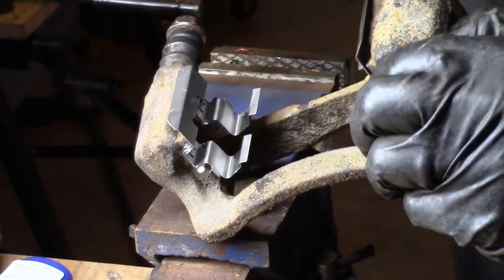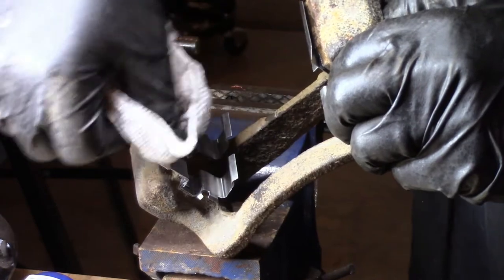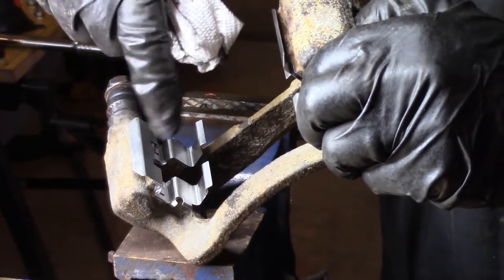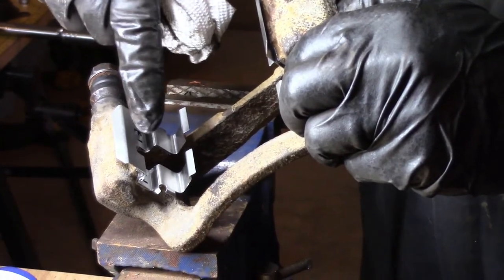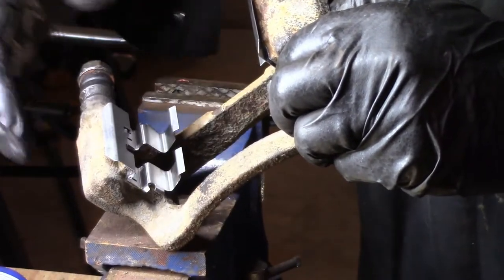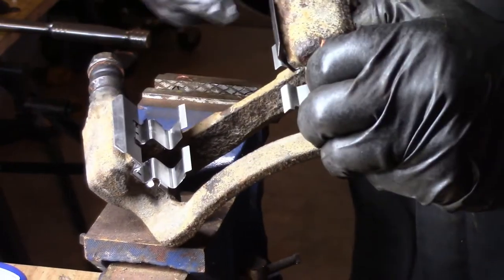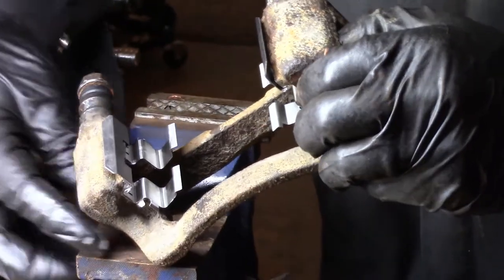Darn it. I find it's not as good if you put grease on here. It's not effective. It actually makes it worse because you get brake powder dust coming off the brake pads, and it will mix with the grease, and it'll cause a crud, and it'll jam your brake pads. So I like to keep it grease free on this side, grease underneath. Anti-seize grease. There you go. That's it. Okay, that's now great.